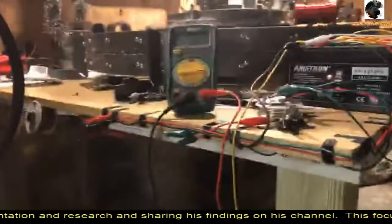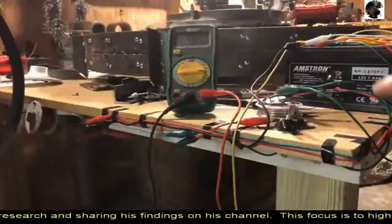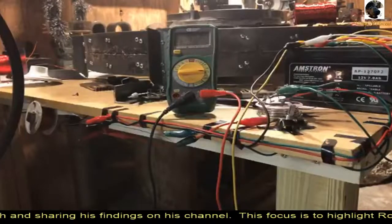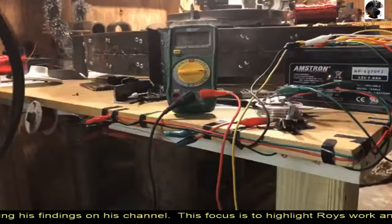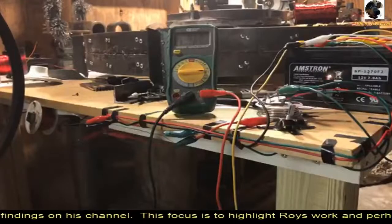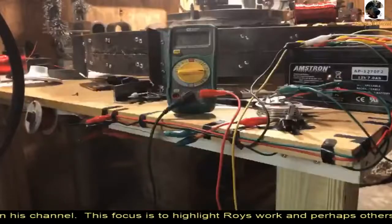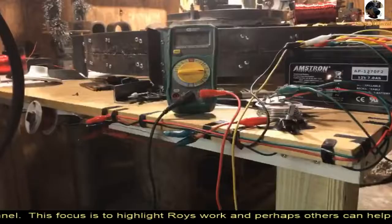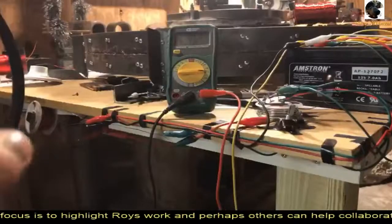13.02. We're putting a lot of pressure in that battery, aren't we, guys? That's 13 volts in that battery. You need a lot more pressure than 13 volts. 13.6, I think. 13.3 maybe. 13.3 is a fully charged battery. So we're way up there. A lot of pressure in that battery. We're overcoming that pressure by this back EMF.